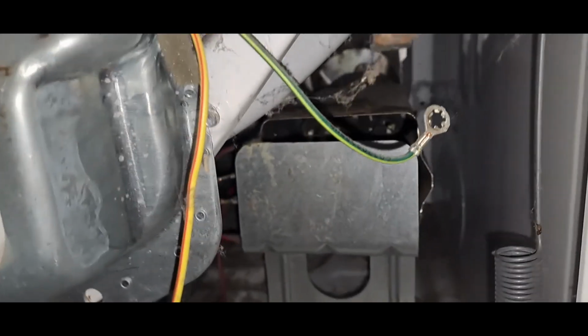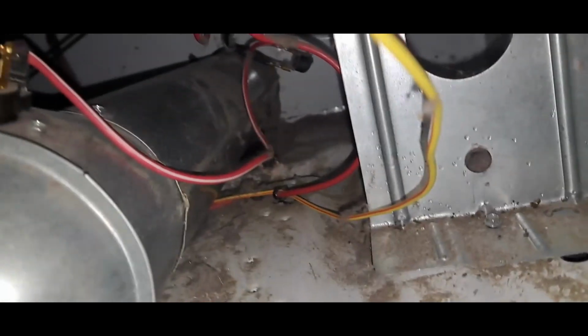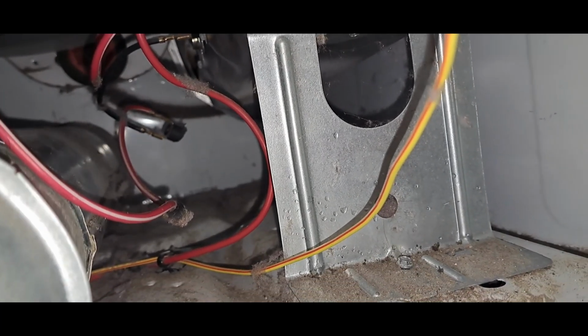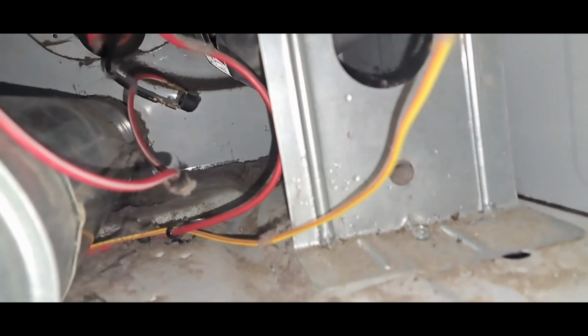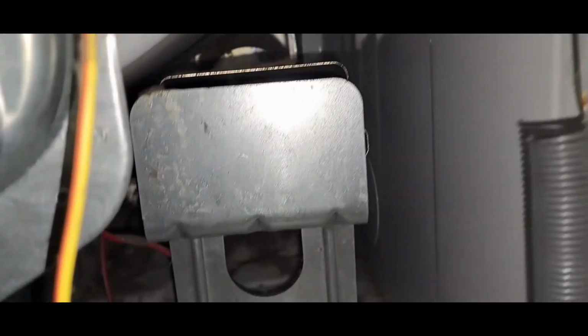All right, this bracket holds the heating element inside there. And down along here, you can see some electronics controllers. There's one. There's another one back there. And some there. So those seem like likely culprits. This guy down here, that's just dangling, seems like maybe an issue. But I also notice that this heating element is supposed to be on that round pipe in the back, and it's not. So maybe something jostled and burnt out there too.